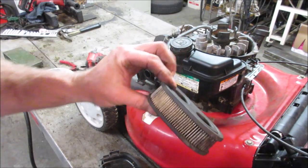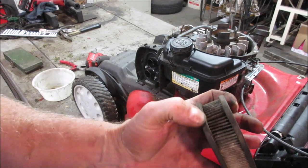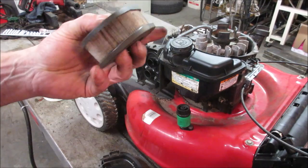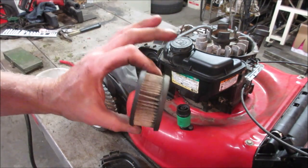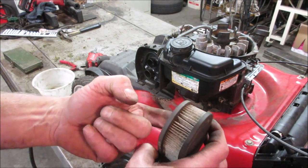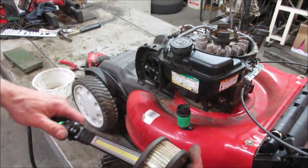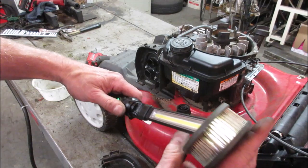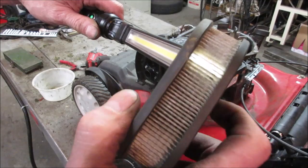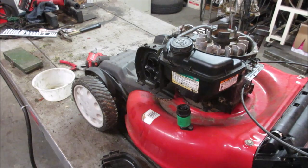A way to tell if an air cleaner is good: put a light behind it. If you can see light passing through, it's fairly clean and will still filter air. If you can't see light through it, it's definitely clogged. This one's fine. Let's fill her up. As far as oil — if it doesn't say what type, generally a 10W30 or 10W40 is what this four-stroke small engine stuff works on. You don't have to do synthetic or anything like that. Generally in our area the mower is going to crap out due to rust before anything else, as long as you avoid the issues we talked about — mouse nests, overheating.